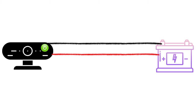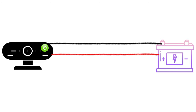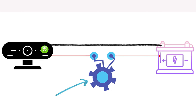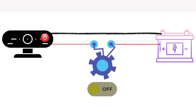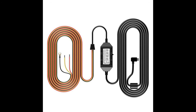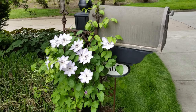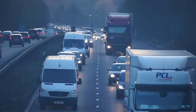This is a dash cam connected to constant power — it continues to run, even when voltage is low, until the battery is dead. This is a battery isolator. When voltage drops below a certain level, it turns off the power before the battery dies. Yes, I know a dash cam hardwire kit has a battery isolator built into it. And yes, I know I'm doing this wrong and probably voiding the warranty. But I don't want to sit around and wait for parts to show up in the mail or go back to the auto parts store to see if they have the correct wire tap in stock.